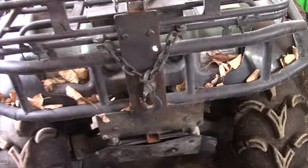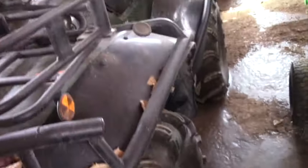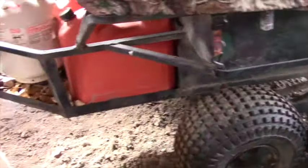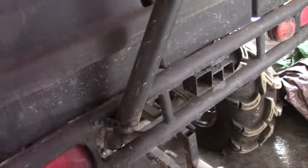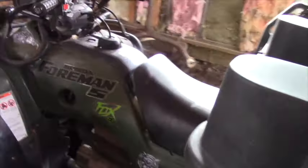We've been very lucky. With both of them having 30-inch tires, they both float, which is really an asset depending where you're going, because you never know what you're going to cross. When they're floating, you just use your hip waders, side-saddle the quad, and use the throttle and momentum of the tires to get across. A lot of times we'll go across a river first, run a cable across, and then winch ourselves so you don't go floating down the current. Both quads have waterproof quad boxes and 12-volt car batteries for winching — the little batteries that come with them get too hot when you're winching. Thank you very much for watching; any questions, let me know and we'll see you in the next video.